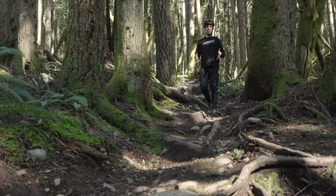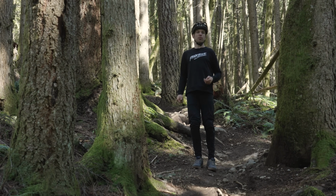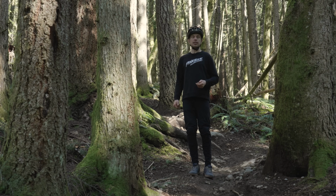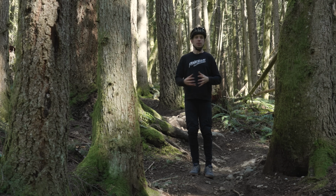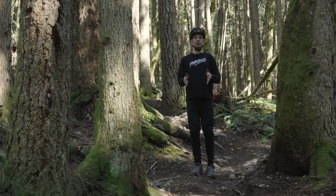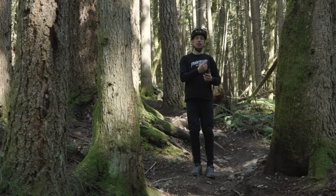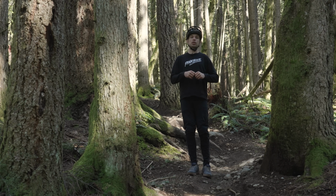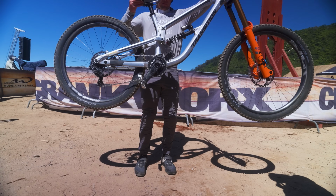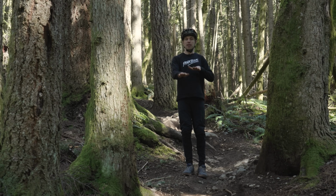Pedal feedback or pedal kickback is a very interesting idea to think about, and as such has provided much forum fodder over the years as people argue about its influence on our mountain bikes. Let's try and understand it in really simple terms. As we compress a full suspension mountain bike and the axle goes backwards, your bike undergoes something called chain growth. As that chain comes under more tension, it pulls at your feet, meaning you get some feedback through the pedals